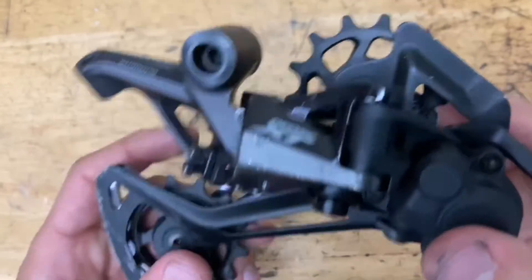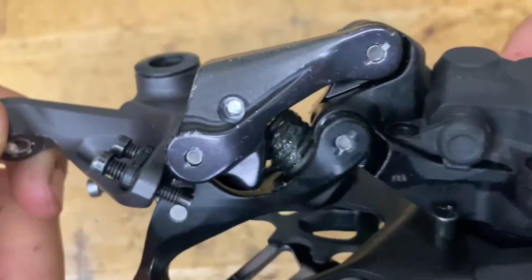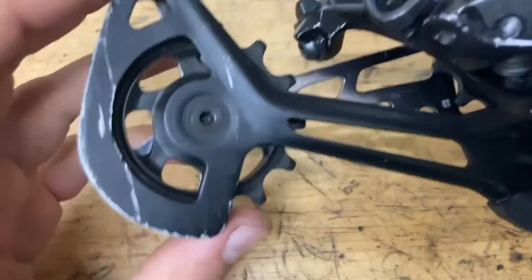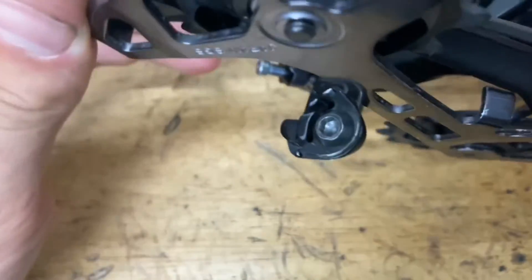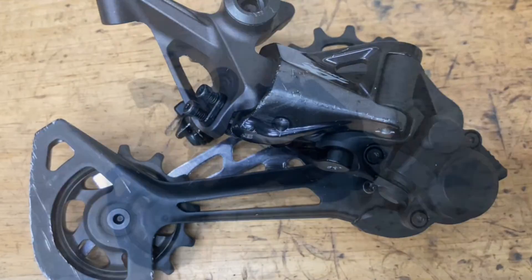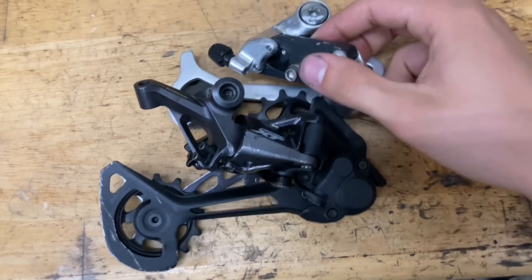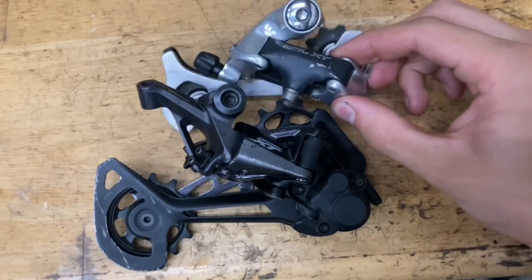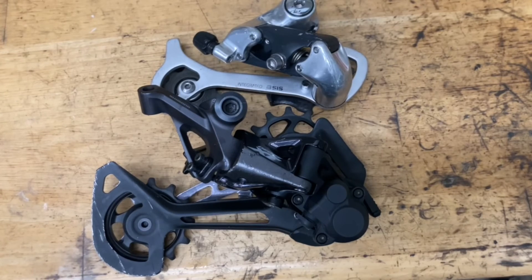To finish up, I always like to put a drop of chain lube on each of these little pivots and put some grease on that spring to prevent rust. Double check that your pulley bolts are snug and spin nice and smooth, then put on your little clamp bolt. Now you've got yourself a fully rebuilt derailleur. I usually work on older stuff, so I just wanted to show how much bigger this new derailleur is compared to something from '97 — like this 739 here. I hope you found this video useful; I'll have all the replacement parts linked in the description. See you guys, bye.